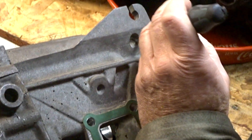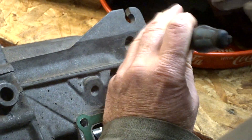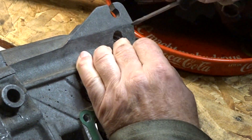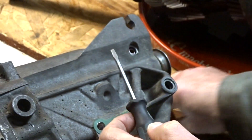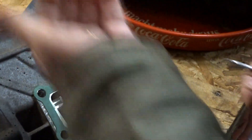Now we want to remove the four 10mm plugs. Do this step before you remove the rear case so the case won't move around — I forgot to do it. Using a medium-sized screwdriver and hammer, just hit the outer rim of the plug until it turns and then pry it out. Take out the spring and detent. There are different length springs so don't get them mixed up.